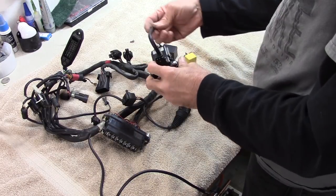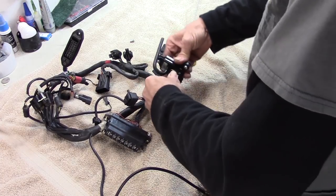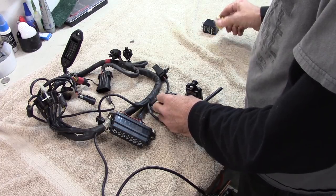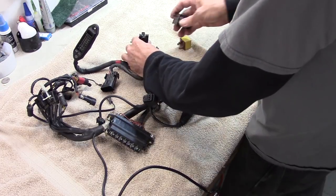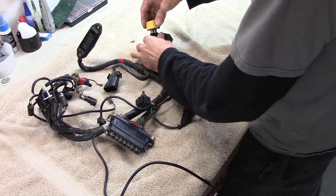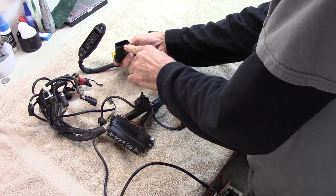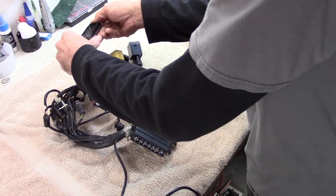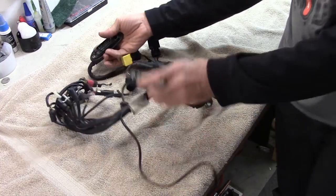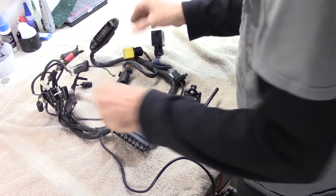This guy looks like a barometric sensor or maybe an altitude compensator. It looks like it plugs into this one. I've got a 10-prong connector there. This one here connects to the rear harness — this is what ties it into the rear harness. There's my fuse block, and then the rest goes up into the instruments. Let's get it on the bike. It looks like this pushes in like that and swings into place.